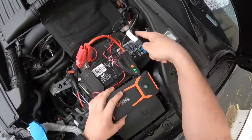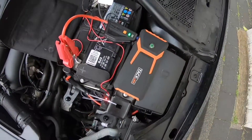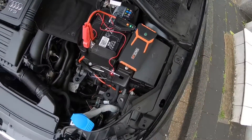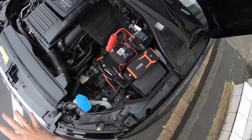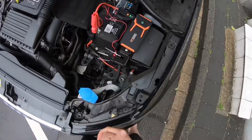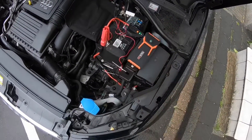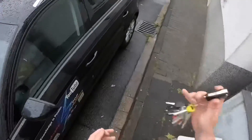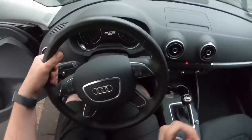Make sure the indicator is steady green. For other situations, if your battery is deeply empty and there is no green LED, then you have to try the boost mode. The boost mode is easy — there is an orange button on top. Push the orange button, and after 20 seconds your connection will be green and you can start.